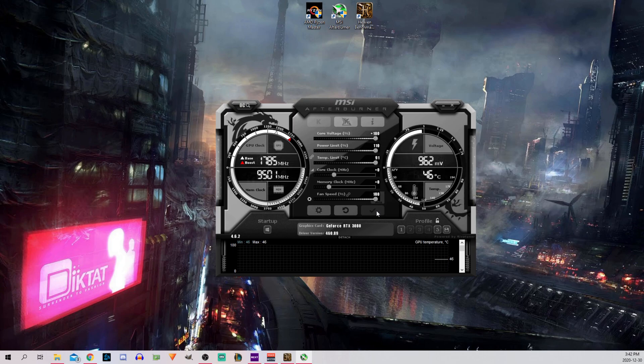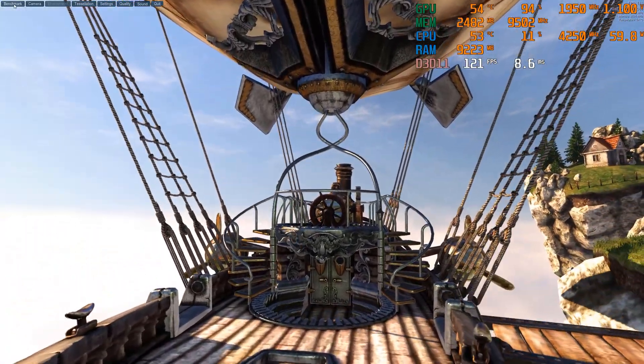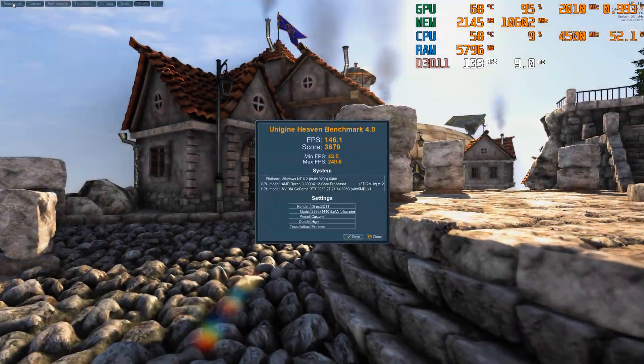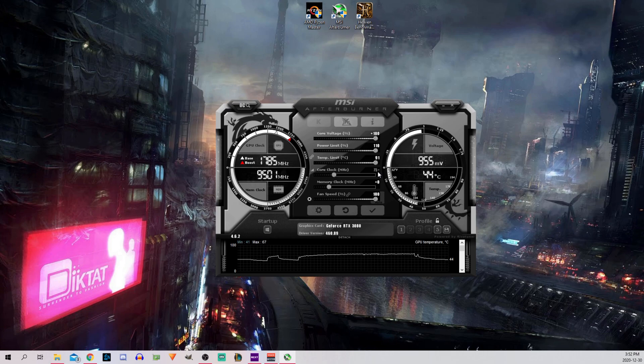I hit apply, and to test my graphics card overclock, I used an application called Heaven from Unigine. This part of the test was a little tedious as I had to sit there and watch each benchmark test, watch the temperatures, as well as watch out for any stutters in the video. I started with just plus 75 core clock, and after every test went up by plus 15. At plus 195, I started to notice the video stutter, which is how I knew that my max was around plus 180. I then kept the plus 180 on the core clock and proceeded with the memory clock boost in increments of plus 100, ending up with plus 1100 without any issues.